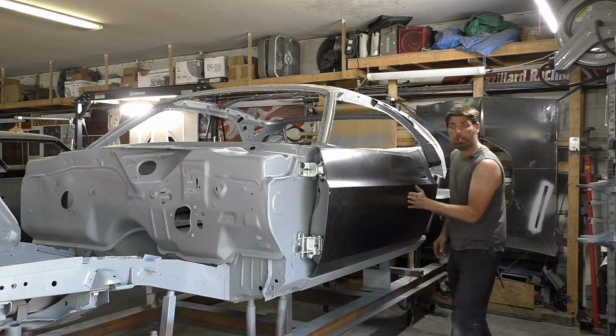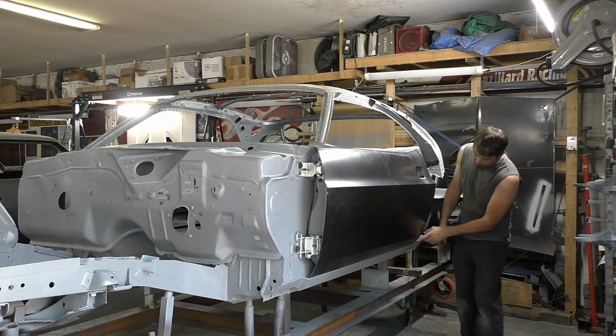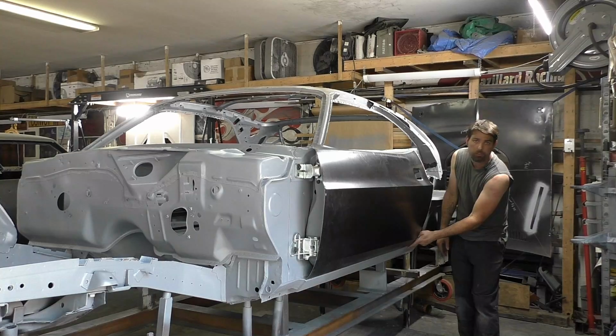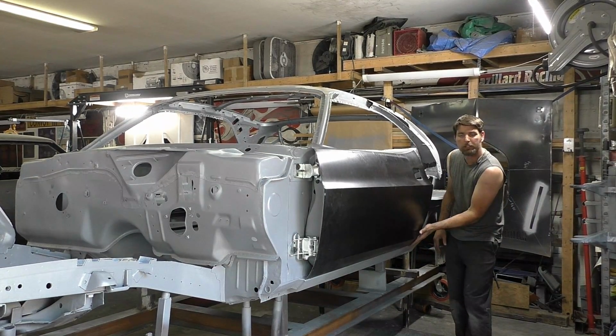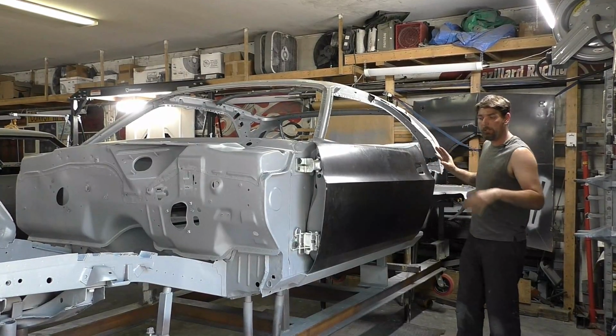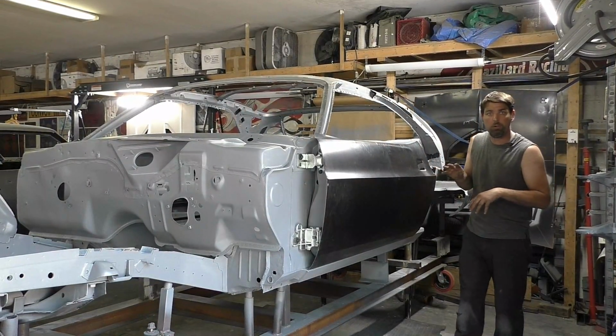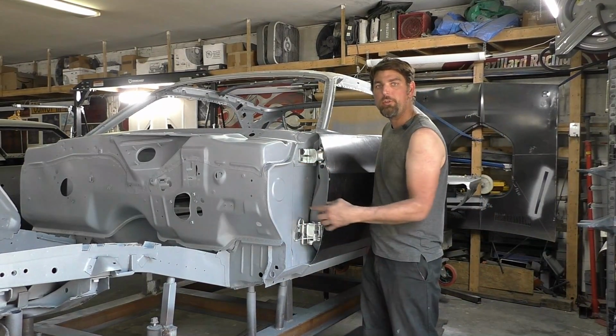You can see the outside came out really good. I'm really happy with them. They're smooth. They usually do need a little bit of work in this bottom corner. So when we hit that point, the Challengers curve a little bit and these door skins like to square off there. But when we hit that point, we're looking really good because that means everything else is on the car. What I did with the doors when we installed them, actually we only have 2 bolts in these door hinges.